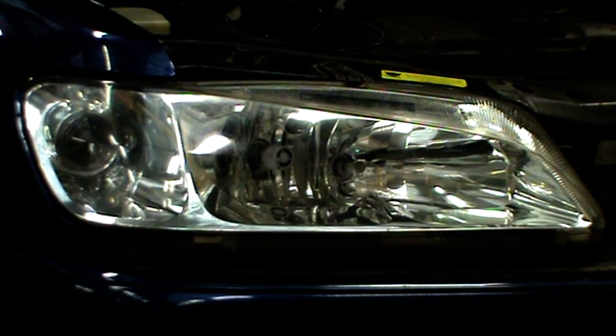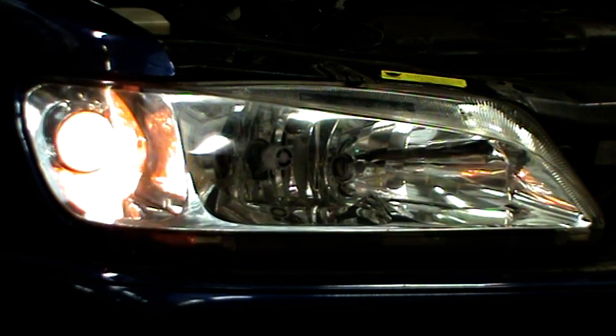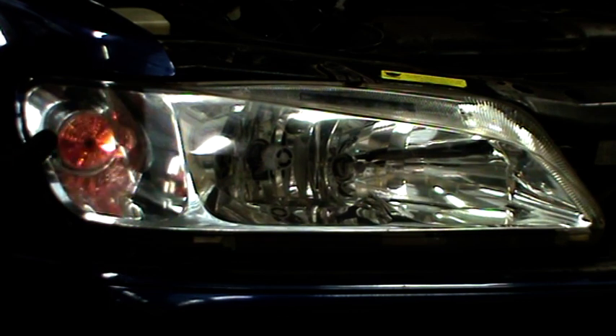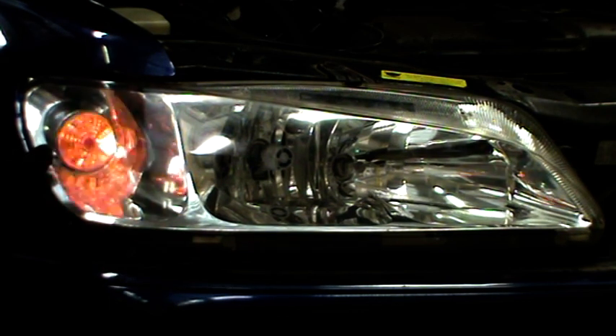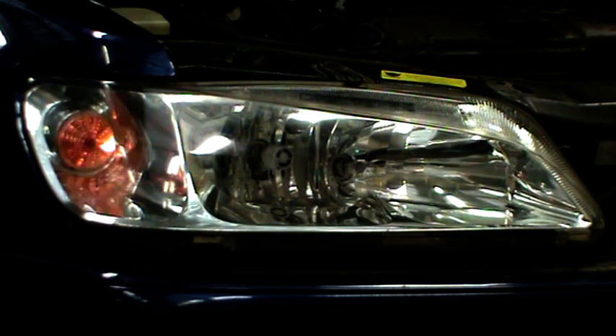As you can see, the headlight is now fitted back into the vehicle - not secured and the trim isn't back on yet. What I'm going to do now is a quick lights check to make sure all the headlight functions work as they should before I secure it to the vehicle. The last thing I want is to put everything back together and find something doesn't work. So always do an early check as quickly as you can. We should have our indicator going now - roughly 60 to 120 flashes a minute, which is an MOT regulation. If it's flashing quickly, it's an indication that a bulb somewhere else on that circuit is not working.